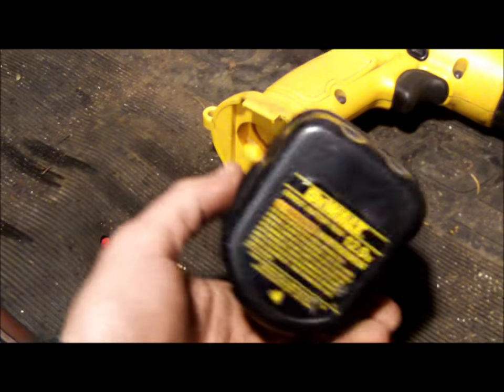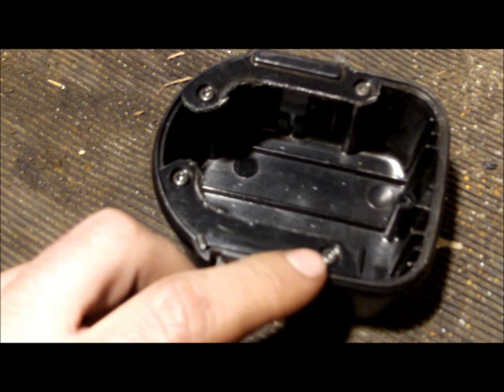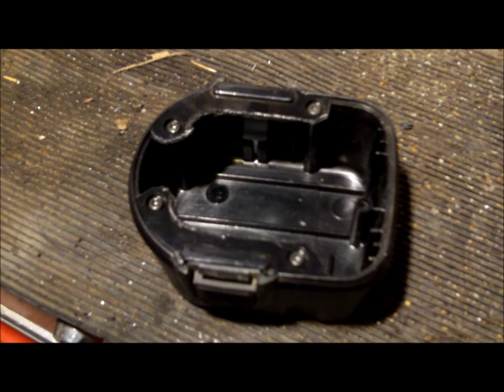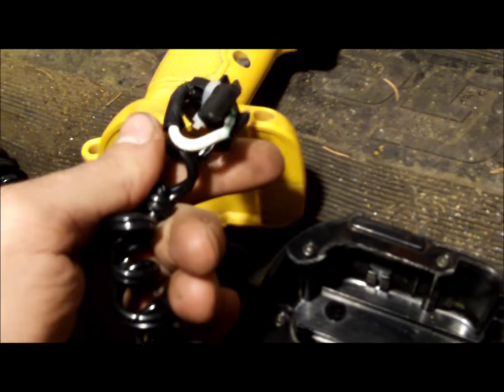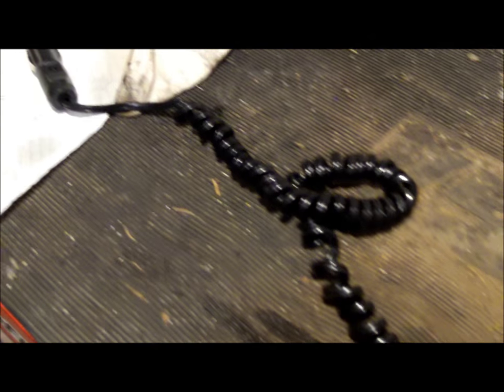So what we did was took the old dead battery pack and took it apart and hollowed it out. I had to cut it and leave these two outer portions on here so it would actually have the clips still on it. There were just some old nickel cadmium battery cells in there. Then I took the top portion of the battery pack that actually has the terminal where it clicks into the other side, broke that off, and soldered on some wires to an old spotlight cable that has the cigarette lighter adapter.